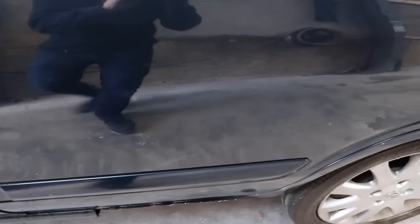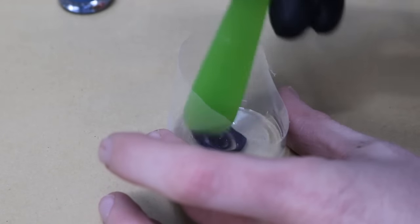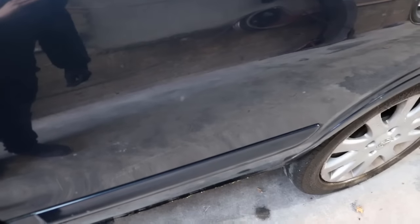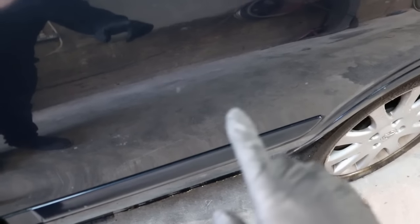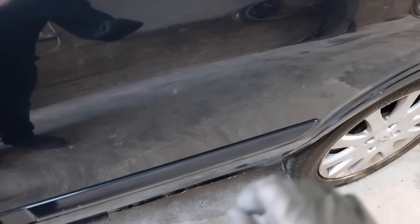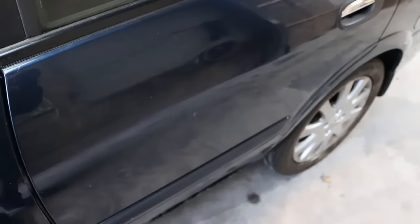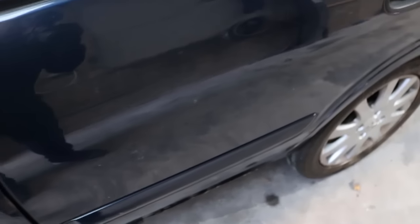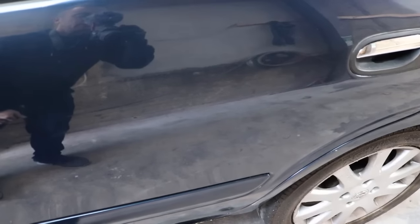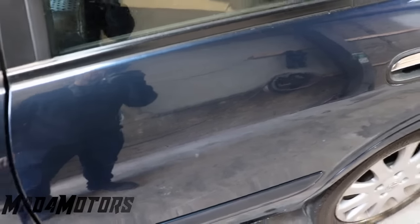It's amazing what you can do with some nail varnish and a little bit of time. We mixed up this colour ourselves and it's something you can do at home. I'm going to go one step further tomorrow and actually lightly sand down this clear coat with about a 2000 grit sandpaper and then polish it up - that way it will be completely invisible. I hope this video has helped somebody with a deep scratch in their car. I know there's nothing worse than getting a really bad scratch, and I hope you enjoyed the video - maybe like and subscribe. Thanks for watching.